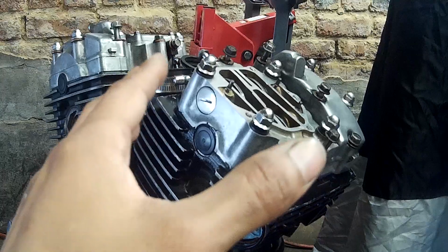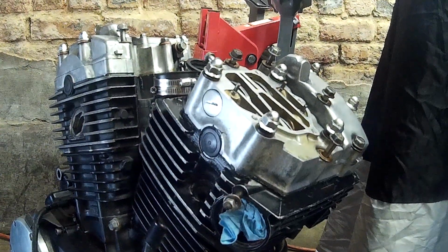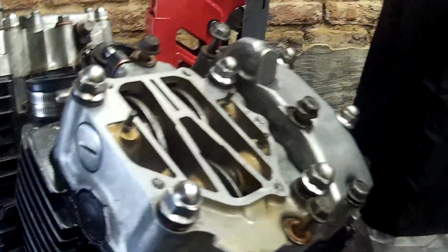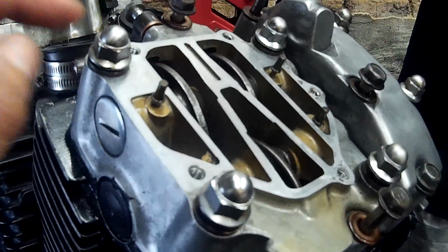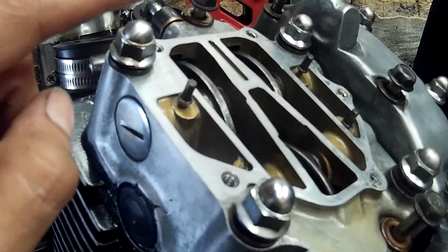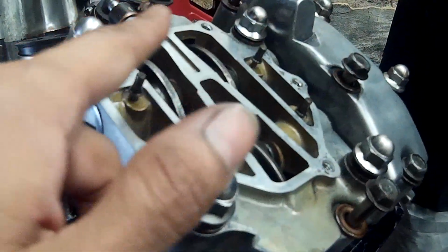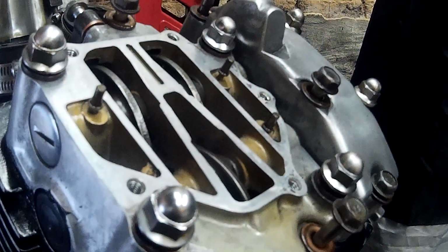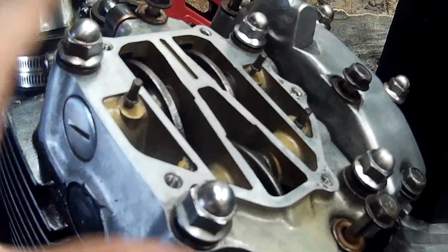I don't know if it was maybe a loose chain or a stretched chain or so. So I did purchase a dial indicator, measured all that stuff, and checked with my shop manual how many shims I'll need. There's 3 tappets for 1 cylinder. One tappet had a shim of 1 millimeter, and the other 2 didn't have a shim at all. Once I did that measurement, according to my shop manual, I need 2.5 millimeter shims. So maybe that was the sound that was coming from.